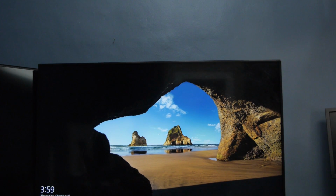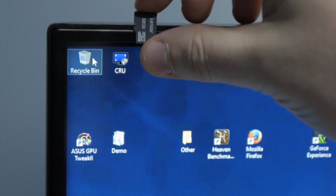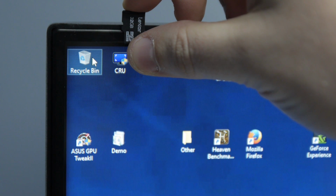And surprisingly, we have a forum post about this monitor and the A399 and some other 40-inch monitors, because 4K and 40 inches really makes sense for a lot of reasons. If you've used a 27-inch 2560 by 1440 resolution display, the density of the pixels in that monitor is basically the same at 4K 40 inches. So we're talking about 108 pixels per inch, give or take. At that resolution, the display is just 40 inches big instead of 27 inches big. So in terms of the size of stuff on your display, it's the same size on a 27-inch as a 40-inch. It's just that on the 40-inch you've got a lot more pixels.